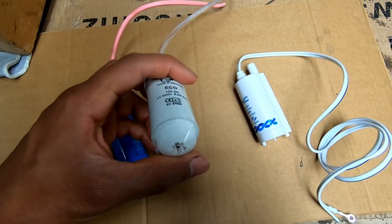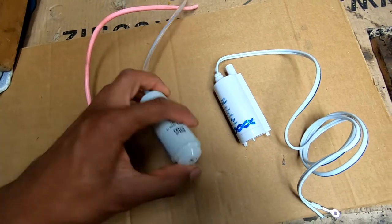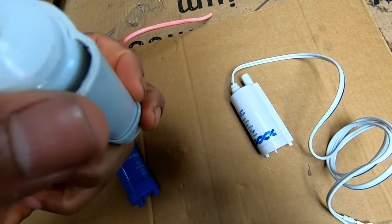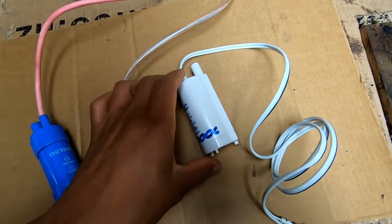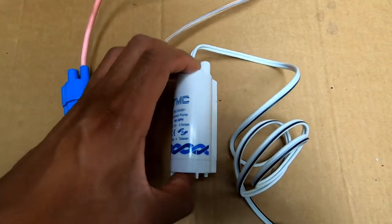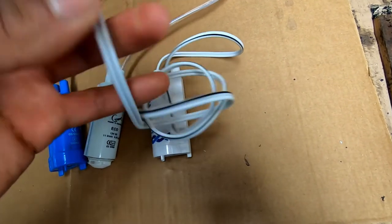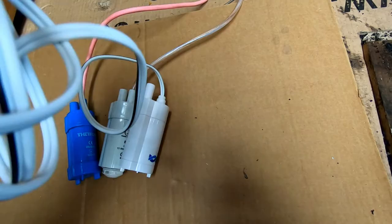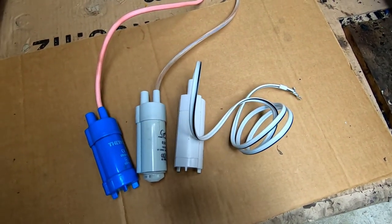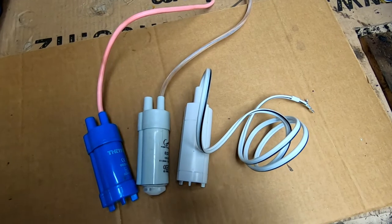This is another type of pump — it also has similar problems. This one was working intermittently, and that's what it looks like on the inside. We cut this one open so you can have a good visual. It's just your impeller and it pumps the water through at the top. We'll be installing this pump today — I'm just trying a different brand, but it's exactly the same. It comes with this sort of terminal, just splice into it and we'll install it into the existing loom. I like to solder these in — that's just my personal preference. You can use terminals or heat shrink tubes with solder, whatever works with your application.